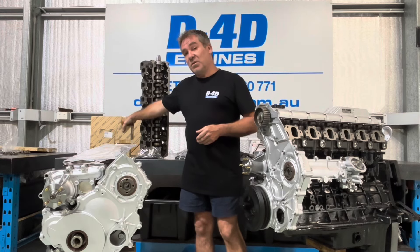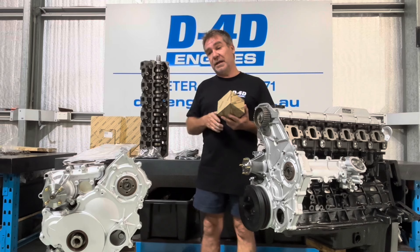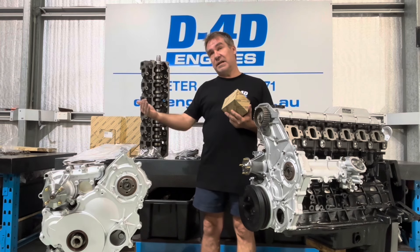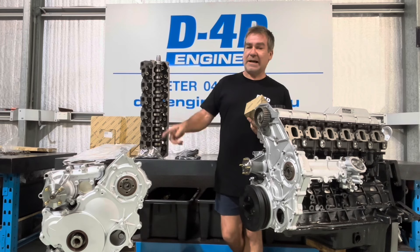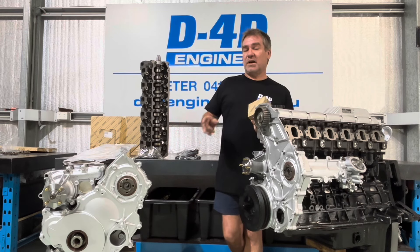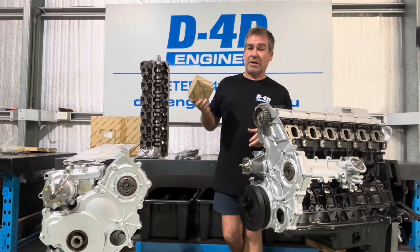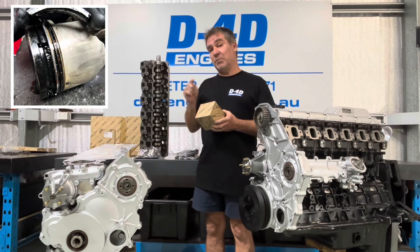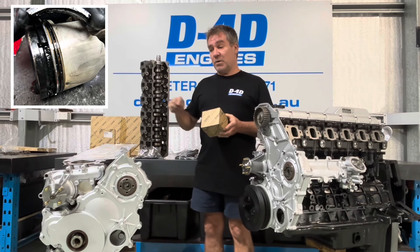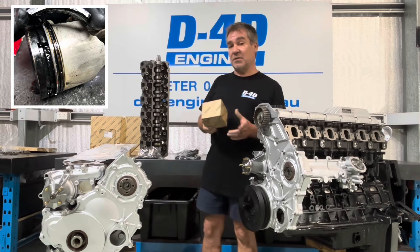The other thing we always use is genuine Toyota pistons. When you put boost in these, you can break the ring lands. People think 1HDT, but the 1HDT has a much lower compression ratio — they're 18 to 1, where the 1HZ is a 22 to 1 compression ratio. The non-genuine pistons can break ring lands. We do have 0.5 oversize genuine Toyota 1HZ pistons, so you can bore the block and know that it is 100% correct.